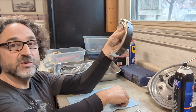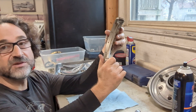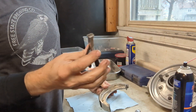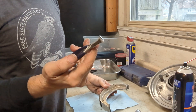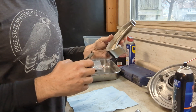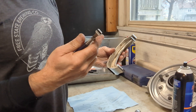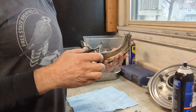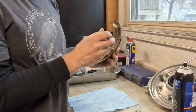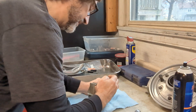Hopefully we'll have some rear brakes again. There are lots of different ways to do this — I'm just going to demonstrate the way I like to do them. To get the old rivets out, you can drill them out carefully, being careful not to damage the brake shoes. I have a flush cutter, and what you can do is use it to snip the rivets and then just push them out.